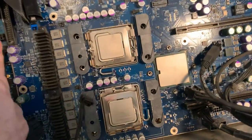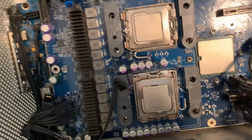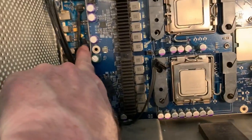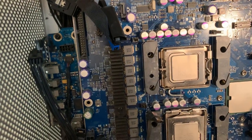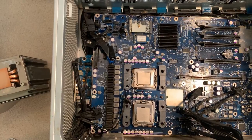It is now free from the case, but trying to get it out is very tricky. There's a small board here for the front IO, and there's a SATA cable that plugs in there — you have to unplug that from this board in order to be able to lift the main board up and out. It's a fiddly process and it takes a while, but it is doable.